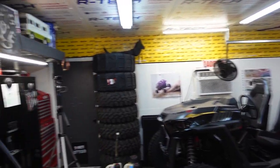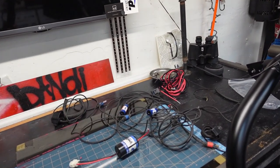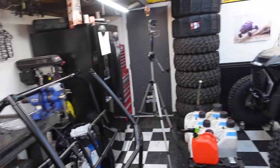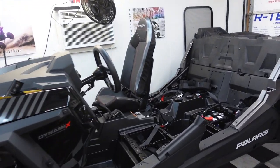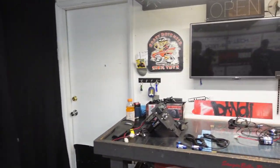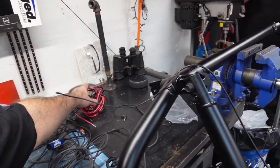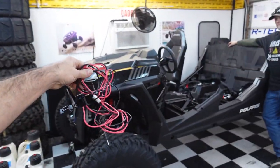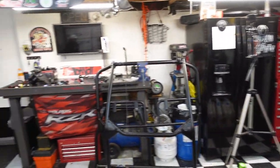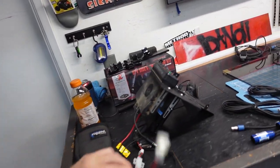Here's the wiring that's going into the car today — pretty much all of this. The radio will go on later once we get the console out. This is the ideal situation to do this wiring. What we do is take the audio filter, plug it into the main power harness, run it all the way back to the battery, and all the way up into the audio filter.